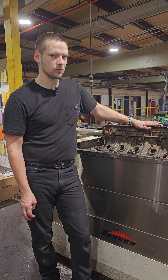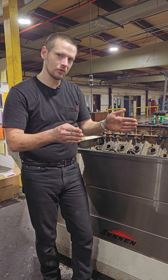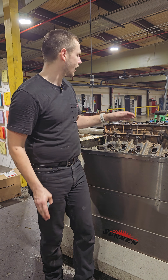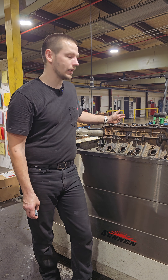These are tricky. 6.0s and 6.4s can be tricky because they don't have main caps — they have a bed plate. So it's really easy to get the bed plate shifted just a little bit and you'll get really crazy numbers on either end. You really want to make sure that everything is on straight. I've got consistent numbers all the way throughout, but they're consistently not where I want them to be, so I know that the bed plate is on straight.